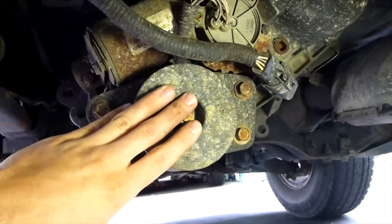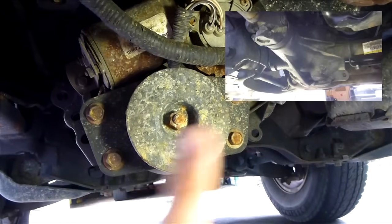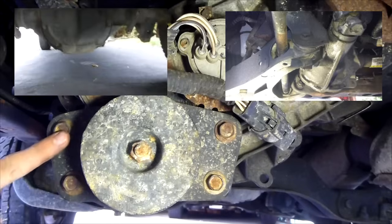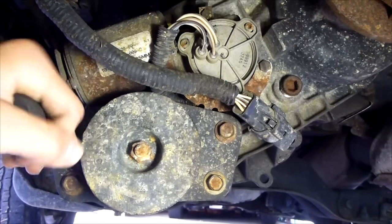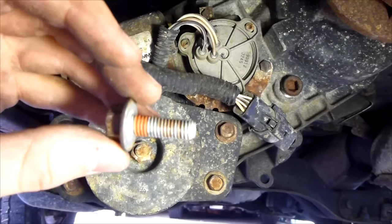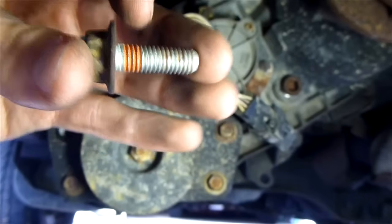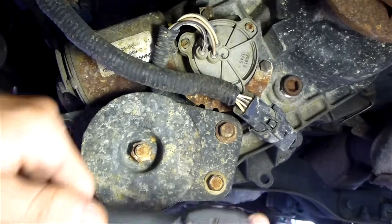I'm also going to change the front and rear differential fluids — you can see the links in the videos and also in the description. So you can see the four bolts you're going to need to undo; they are a half inch. You can see they have red thread sealer which helps them stay on — it's like a glue for the threads because there's a lot of vibration here. It would probably be a good idea to put that back on when you screw these back in.